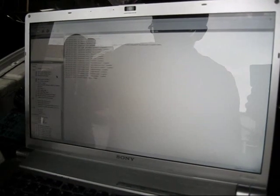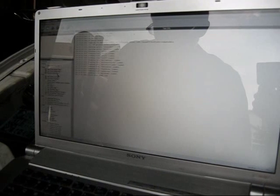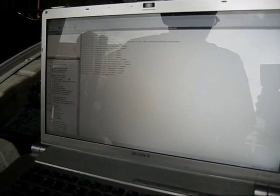What we're looking at here are all the tables in the ECU that we've found so far. The only ones we need to modify are to get the vehicle going. I'm currently running stock EVO fuel injectors — 560cc fuel injectors — and also a stock EVO MAP sensor. So what we need to do is change the tables in the ECU for the fuel injectors and for the MAP sensor.